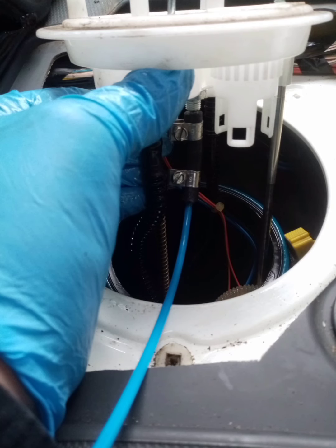Using the black hose supplied, connect that to the underside of the fuel pickup pipe and tighten with a jubilee clip. On the opposite end you have the blue 4mm pipe going into the black pipe — again tighten that with the jubilee clip. The blue 4mm pipe now needs to be placed into the sender unit reservoir. Be careful where you place this so you don't cause any issue with any other wiring or fittings inside.